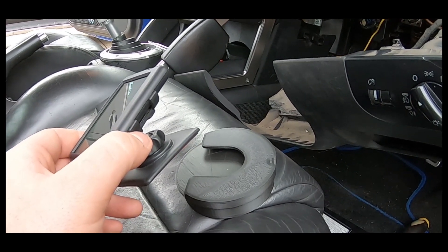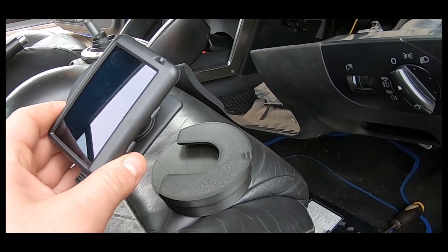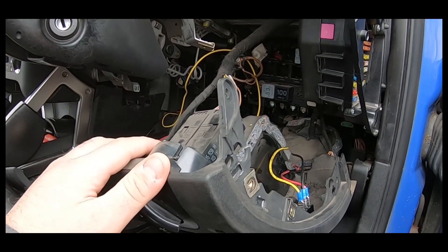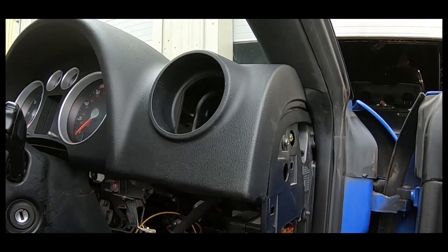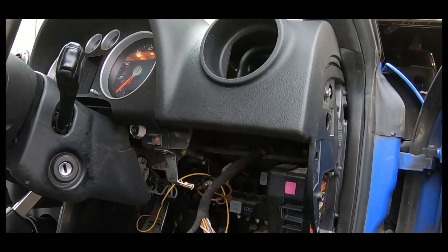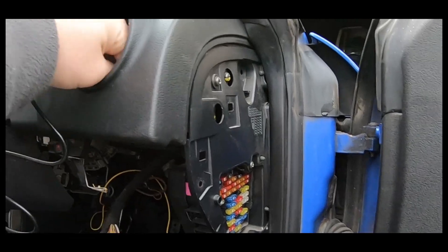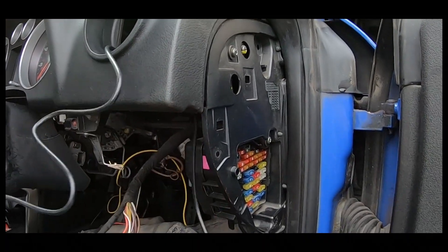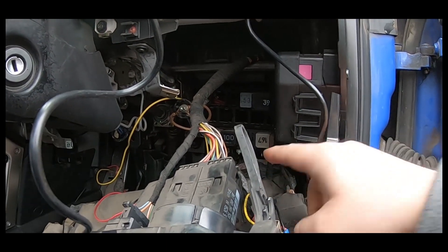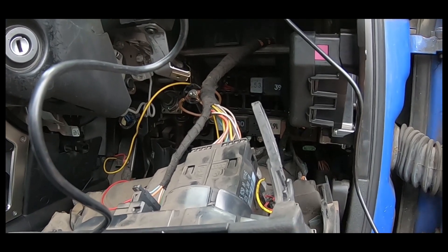So I'm going to quickly show the installation. I won't show everything but I'll show enough because it's quite straightforward. You need to drop, or at least half-drop, this lower trim if you're going to be putting it in this vent — same goes for the vent on the other side. You'll need to feed the plug end of the cable, which is quite long, through there and pull it out of the bottom, then run it over the back edge, coming out underneath so you can plug it into the diagnostics port.